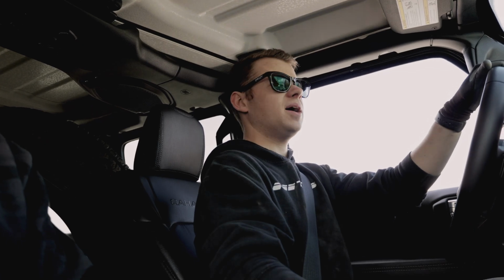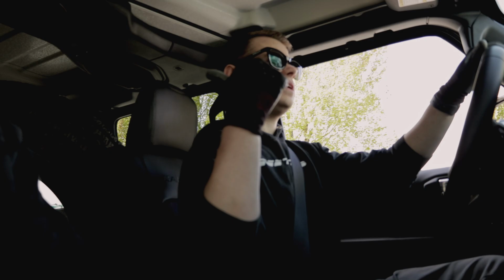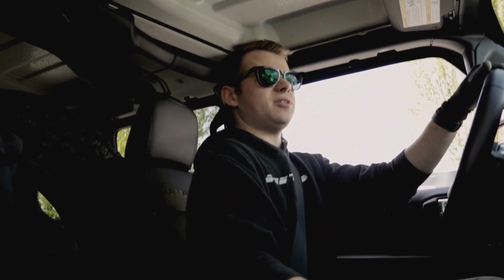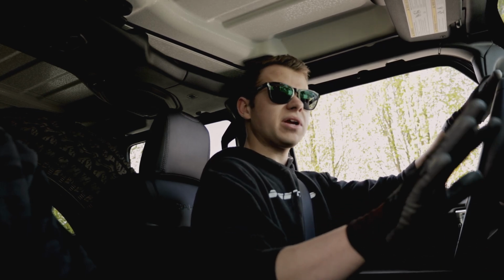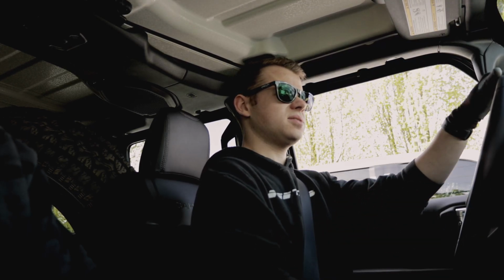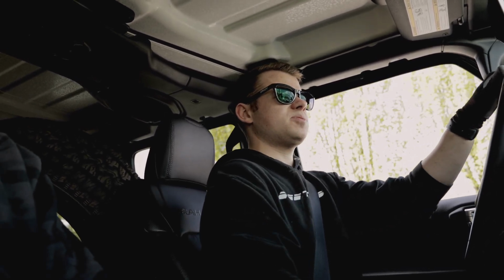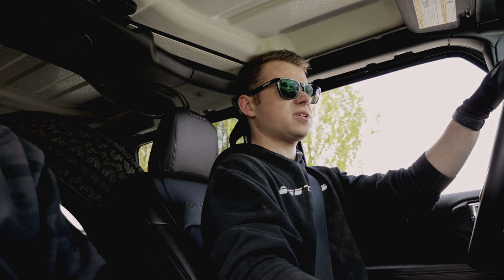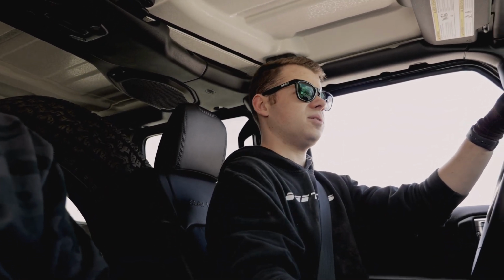It does, right? Not only is the circumference of the tire bigger, but typically, larger tires are heavier, right? So them being heavier requires more juice to get rolling from a start. So you can expect somewhere in the range of about 10% reduction in the full electric range, which is really not too unreasonable. You'd see the same amount of range decrease in an internal combustion Wrangler as well.